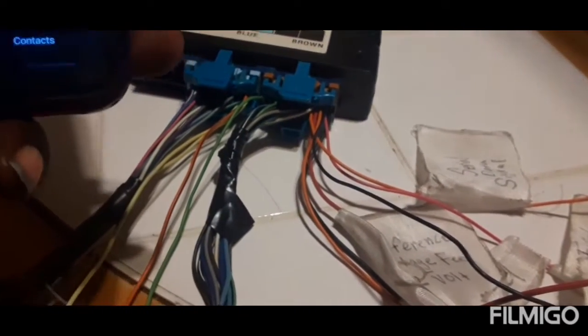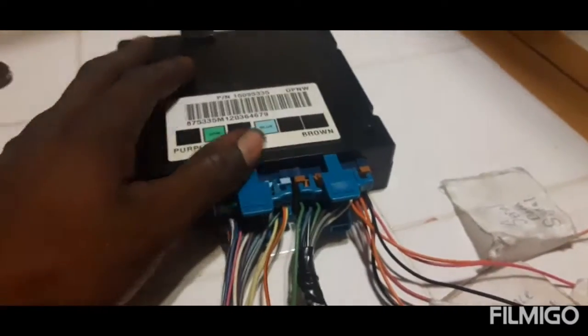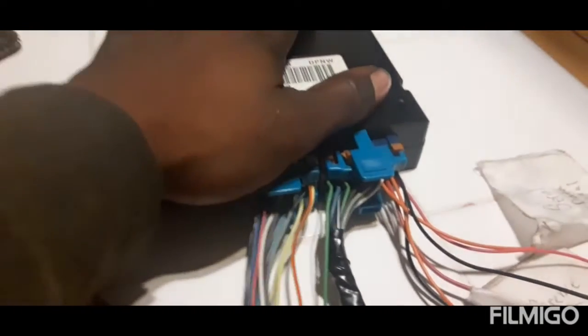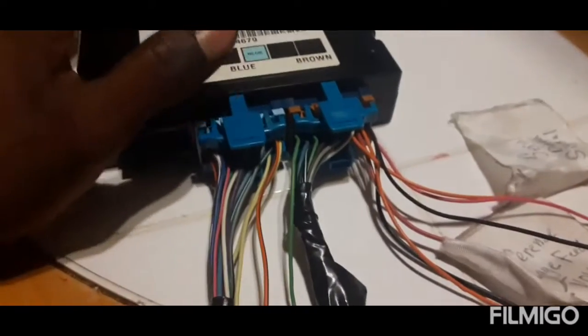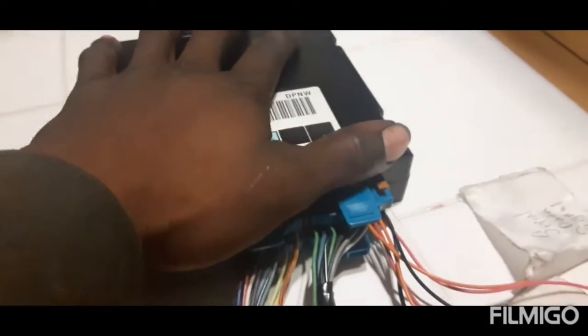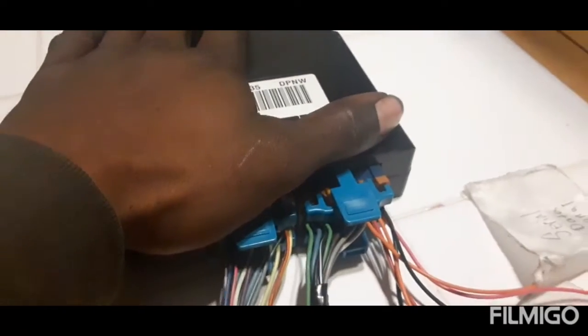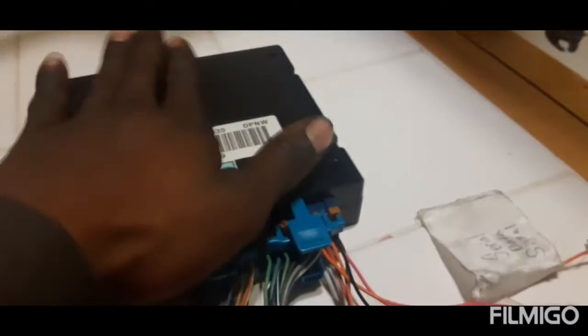From that I knew how to wire the BCM up to the computer. It's fairly simple once you have it — the serial data on the BCM has to match the serial data on the engine computer. You can't just grab one of these boxes from the junkyard and apply it — it won't work because it would trip the anti-theft since the serial numbers don't match. That's why I had to get a matched computer to run my engine.